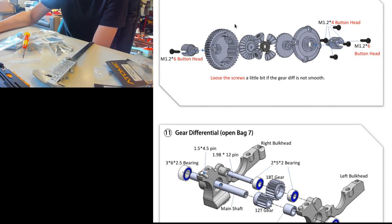And under high speed, because I put a very, very high speed motor under it, it spat the grease out through this gap here, or the seam. So hopefully this is recessed. And if this is recessed, then I won't have to worry about it. And I'm hoping that's plastic as well, because this is already very, very heavy. And the less weight you have on here, the more responsive to acceleration changes the car is.